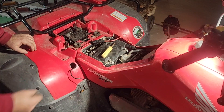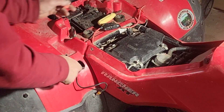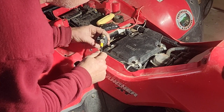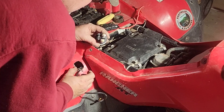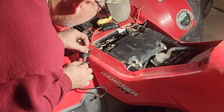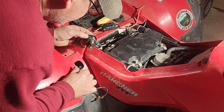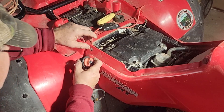The negative cable is long enough - there's still a little bit more under there. It's a nice heavy end on it but it might be too large. This one is too small so we'll have to put a new end on that. I believe this is three-eighths; that looks like five-sixteenths or a quarter. I might be able to drill it out, but I think I have to just cut the end off, which is a shame - I kind of want to keep the factory stuff together. We've got to bring four wires up - that's why I wanted something easy.